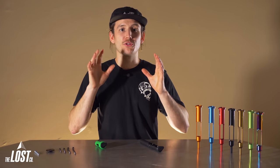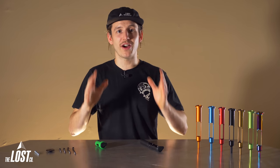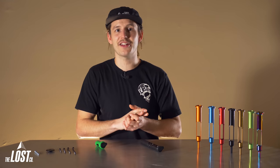If you already had your stem installed and tight, no need to loosen it up before installing the carrier. But if this is a new bike build or you loosened your stem's pinch bolts, just tighten those back down to the stem's labeled torque. Now before you hit the trails, be sure to go door to door and let your neighbors know that you finally got that sweet multi-tool stashed in your fork.